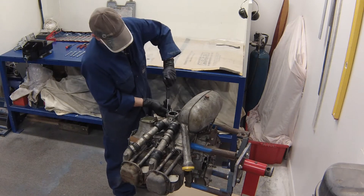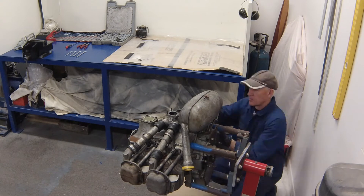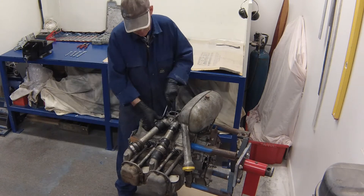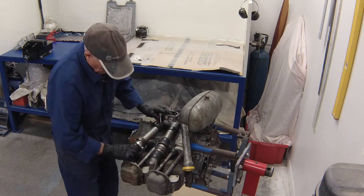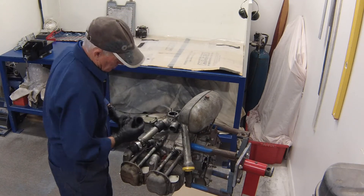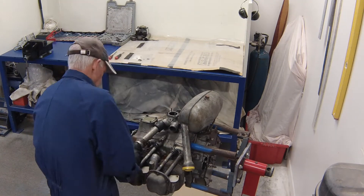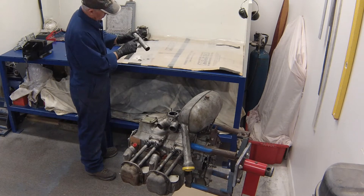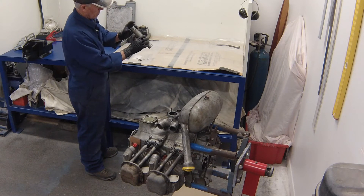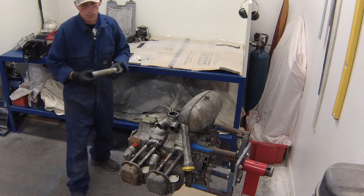Next is to remove the rubber slip joints that connect the cast manifolds from the bottom of the crankcase to the cylinders. They are connected via an aluminum tube, and each aluminum tube has two rubber slip joints, one on each end. You'll need a flat-bladed screwdriver to undo all the clamps and then work the clamps back so they are located between the two rubber joints. You may have to use a smaller screwdriver and wedge it down between the rubber and the aluminum tube and the cast parts of the manifold, as over time the rubber bonds to these surfaces and it's quite difficult to pull it back with your hands.